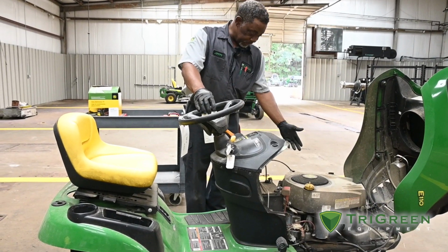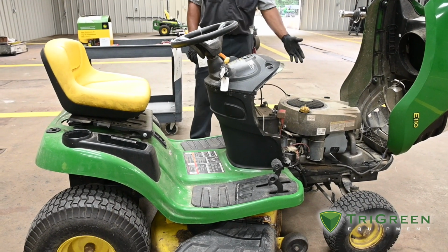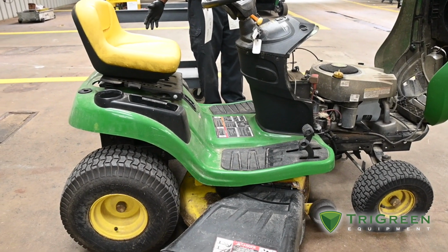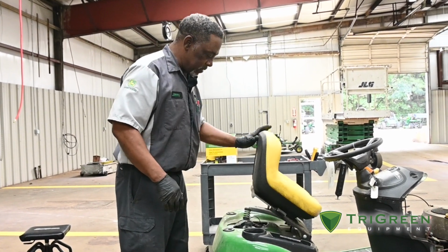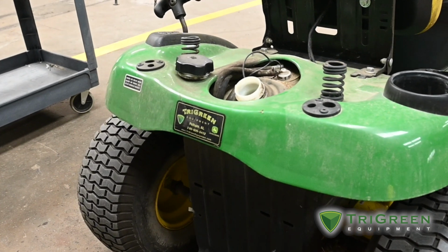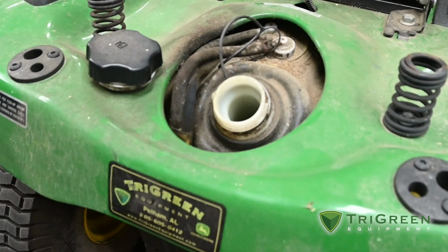Look at my tires and air up each tire to the correct pressure. Front tires should be 14 psi. Rear tires are at 10 psi. After I've done all my oil change and spark plug replacement, I'll come back here and make sure there's no debris just sitting down there that I need to remove, because we don't want debris going in there and clogging up your carburetor.